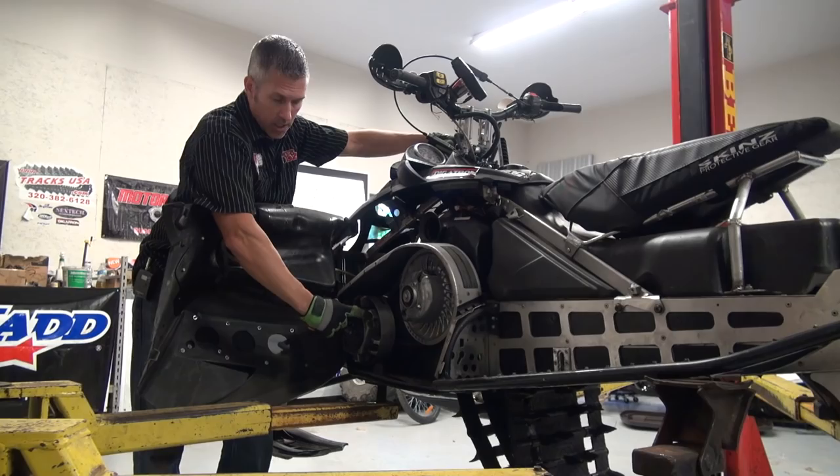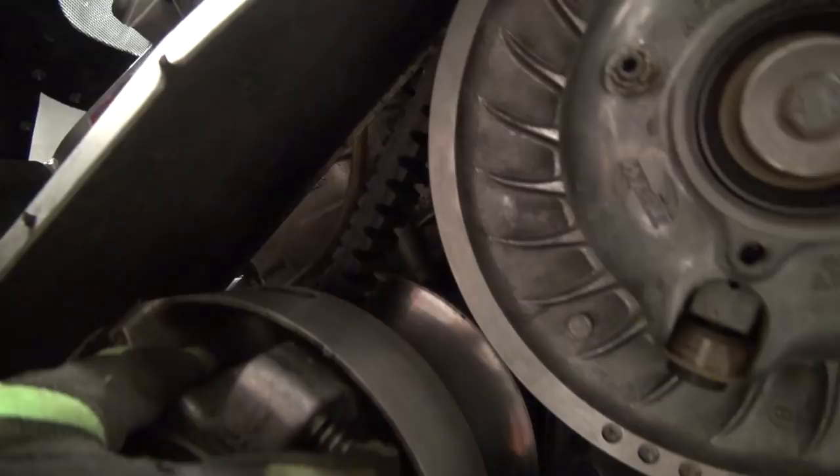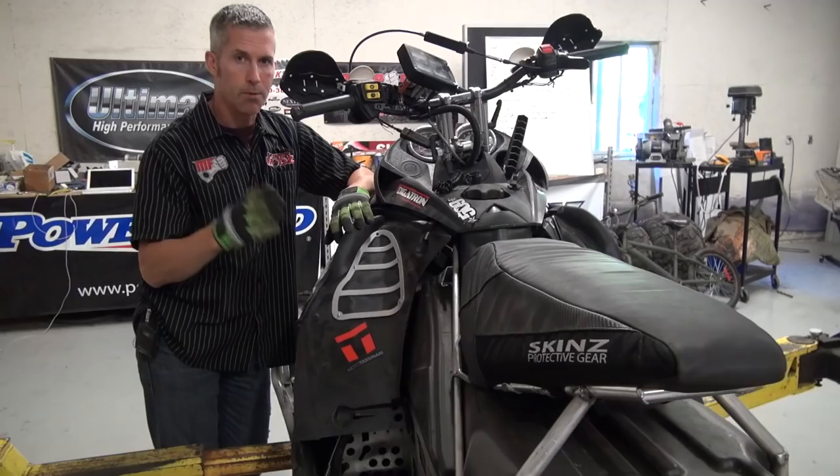You can also put these little quick clickers on here. Depending on the type of day you're running, if you're pulling up a hill and you notice you're not quite getting your top RPM, you can make a quick adjustment with the quick clickers and get the 100 or 200 RPM that you need. Or maybe you're turning too much RPM — you can ramp it down a little bit.